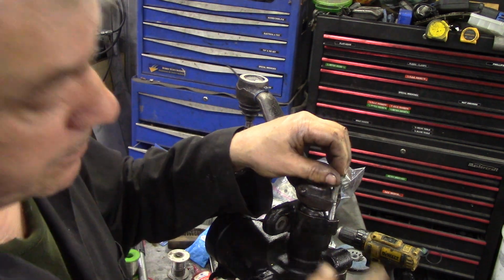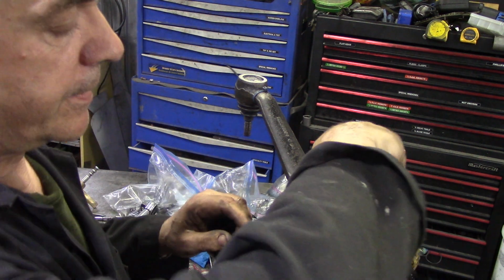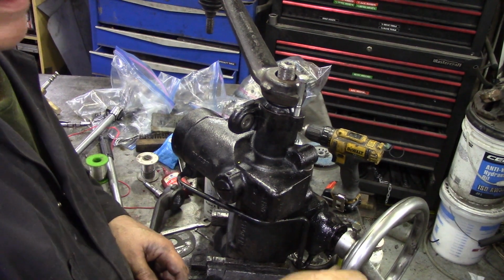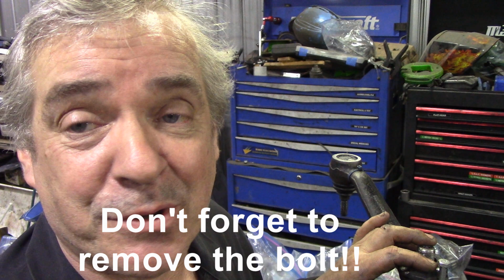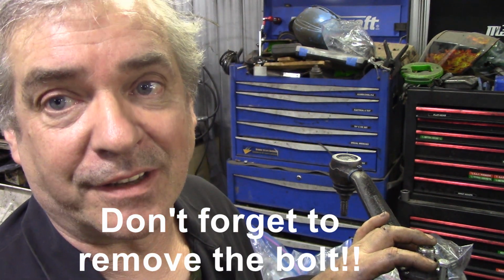especially with a bit of shank on the bolt, and wiggle your steering just a little bit, and that bolt will lock the steering firm. Alright? You won't have to adjust anything. Now that's good. Now this drop arm must have been out of a blue box, because the slot was only 6mm and we need 8mm, so I had to grind it out a little bit.